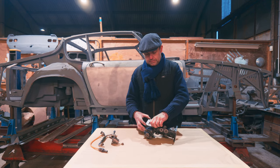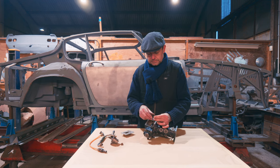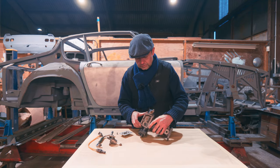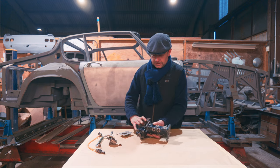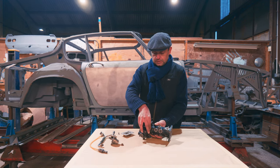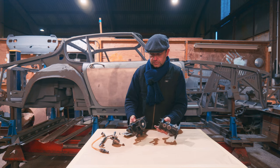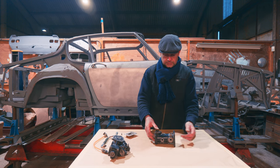And then under here we have our actual control units. This shows our actual controls. Effectively, this slot here is what alters the fuel trim, but we'll have a look at that another time. For now we're going to concentrate on this bit. So we'll take the metering head - or the control head - off there. I don't know the correct name for it, but anyway. This is all our vacuum and control system. There's our diaphragm that it all works for - we'll have a proper look at that later. That's the high pressure in, that's our return, and obviously the drive comes in the end here.